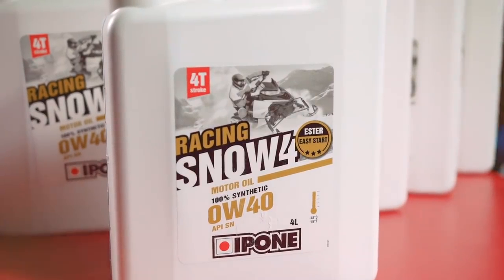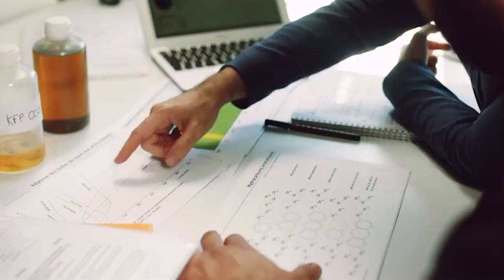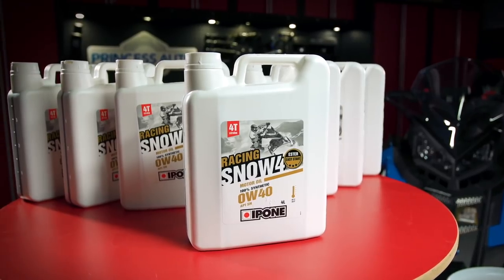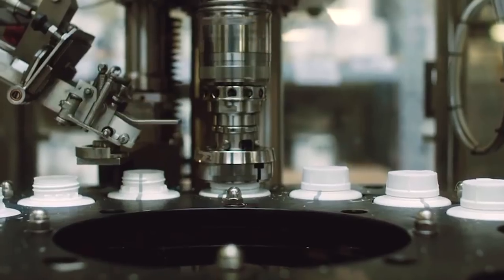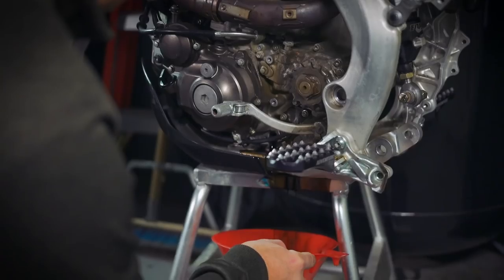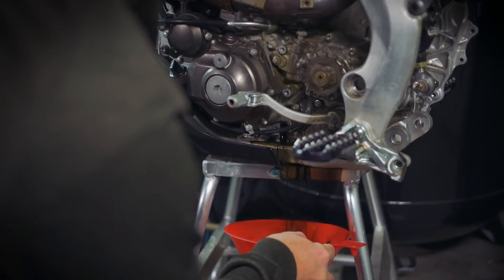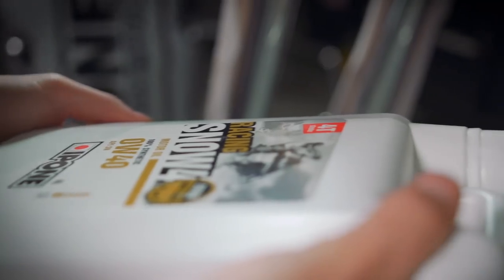Ipone Snow Racing 4 0W40 4-Stroke Oil is an ester-based oil blend. Ester-based oils are of the purest and clean-burning category — the oil is chemically synthesized from organic acids and alcohol elements. It's man-made and not refined from petroleum or hydrocracked oil. This is important because ester-based oils are superior to petroleum-based oils in many ways. Petroleum-based oils have a natural wax in their chemical makeup and require solvents to maintain viscosity at lower temperatures. Over time, those solvents evaporate and your once 0W40 oil may change to a 5W30 or even a 10W20, and the end result is a much thicker oil with a higher pour point that causes your 4-stroke oil pump to work harder and provides less protection at startup.